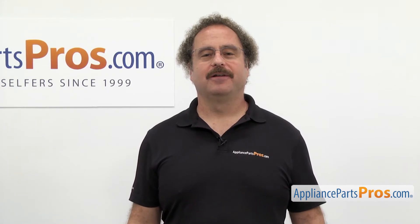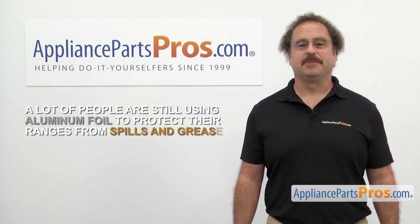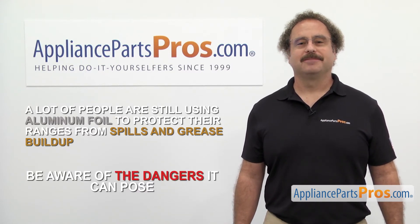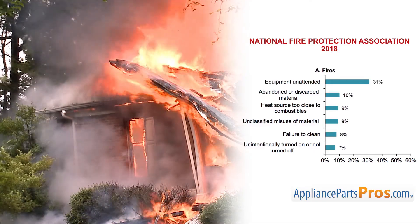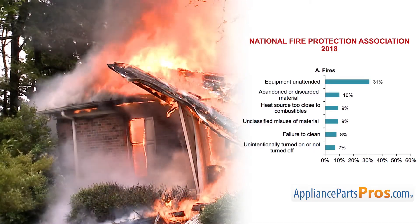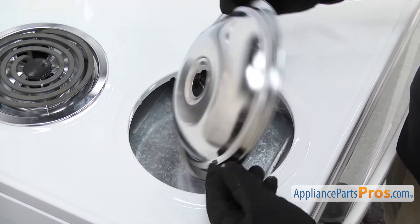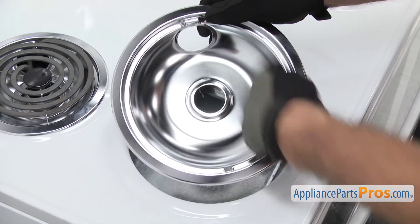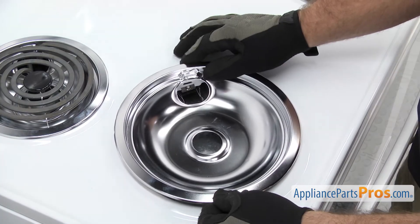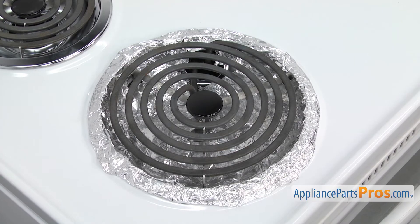Now here are those safety tips we mentioned earlier. A lot of people are still using aluminum foil to protect their ranges from spills and grease buildup. Although it may seem like a good idea, you may not be aware of the dangers it can pose. Firefighters respond to over 170,000 kitchen fires per year, and failing to keep the range clean is linked to more than 13,000 of those. On electric cooktops, many people cover the drip pans with foil so they don't have to clean them. But this can cause moisture retention, making them rust even faster, block air flow, reflect heat back into the elements damaging them, or if the foil touches the element, it could be a shock hazard or start a fire.